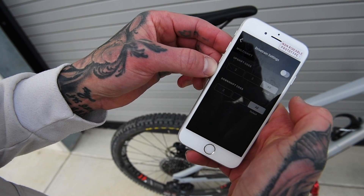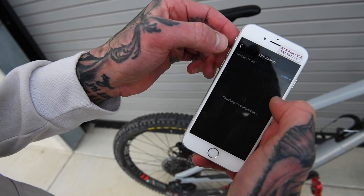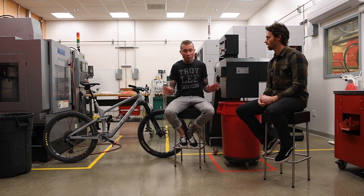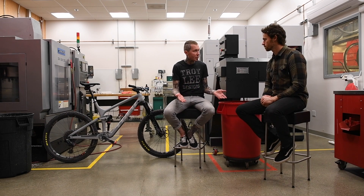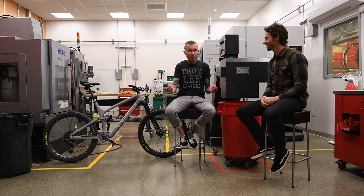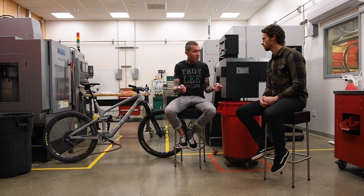This is the multi-shift function where you can turn it entirely off so nothing will happen if you hold it — it'll just be one shift — or you can do multiple. One of the biggest things we wanted to instill is that you don't have to have the app — they're just bike parts. You pull them out of the box, pair them, and go ride. A lot of things have changed now that we're not cable-actuated. There's no barrel adjustment because there's no cable to over-tension or under-tension. We call it trimming — there's a button on each of your controllers, whether it's a Reverb controller or Eagle AXS controller, that allows you to trim.